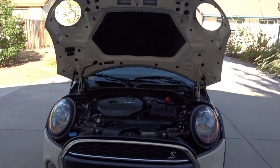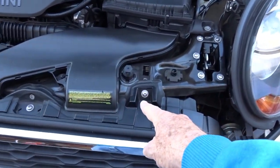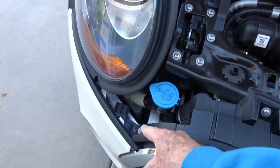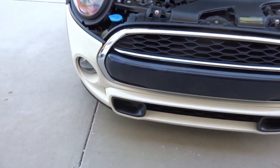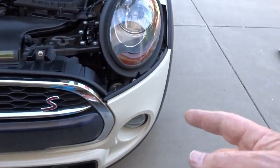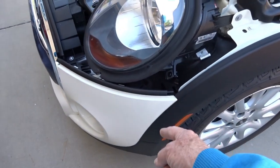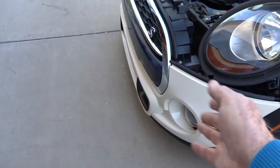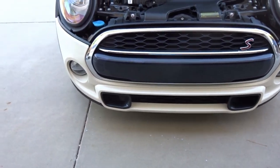So of course, open the hood. Take a look at everything before you start taking things apart. There's five of these torx bolts on the top piece of the front clip — three in the middle, one on each end, and there's one around the corner which I'll point out later. Put something soft down on the ground so when you take it loose, it doesn't crash. Good luck.